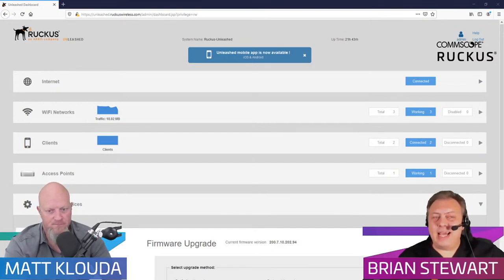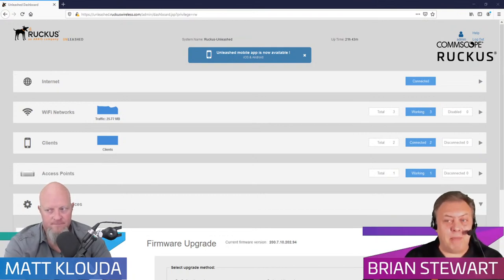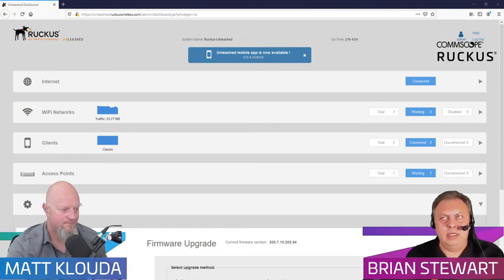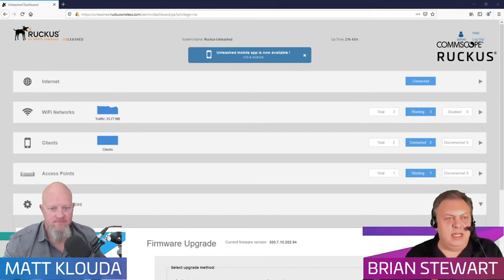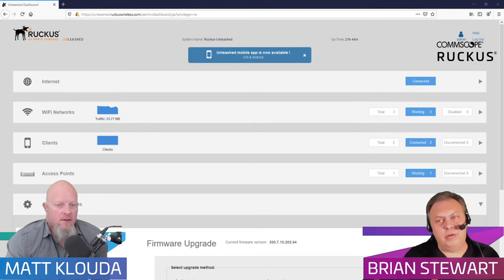And in case it did actually give you the same network name and the same passcode, in case someone had just set both of them up the same way, which whoever did the initial configuration might have done, you can get some really strange behavior, especially if you use a provider like T-Mobile or AT&T that has voice over IP, so you can do voice over Wi-Fi on your cell phone. When it switches between those two networks, it's not going to recognize that as the same origin network, and it's going to drop the call, and you're going to have a lot of other unusual behavior. So absolutely.